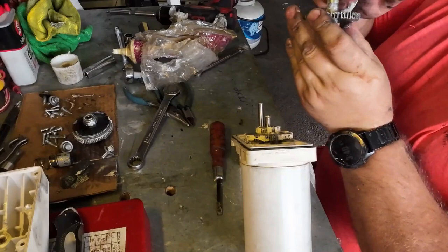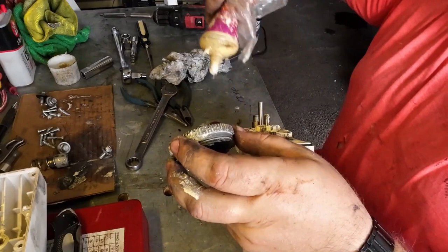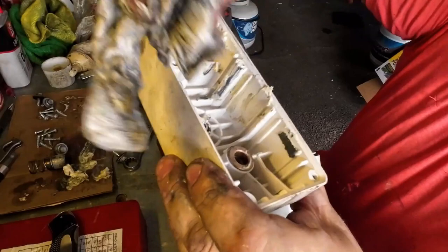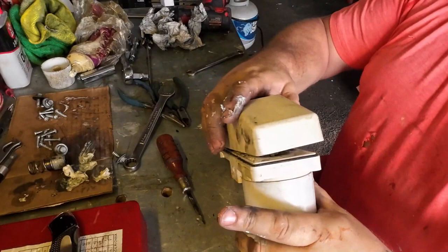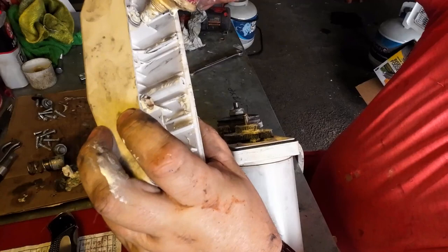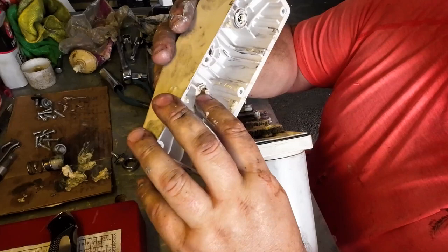I'll put some grease on this to go down and lubricate inside that brass bearing a little bit, and grease on the gear. The clutch we're going to leave — we're not doing anything to it, seems to be normal. Let's put some grease on top of there. Put this guy back down in here. Make sure this rubber seal is round to keep moisture out — just around the top on there. Stick the nozzle inside there and grease up the top of this gear over here. That one goes up just into a piece of plastic.